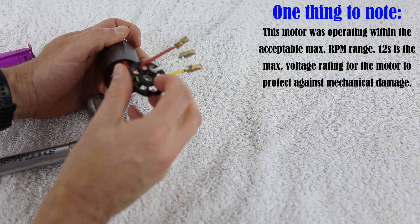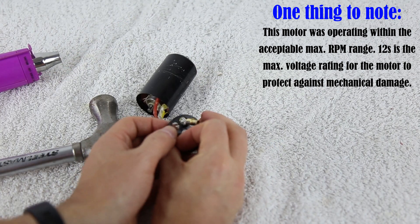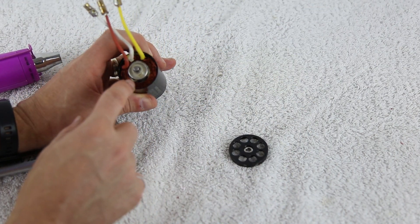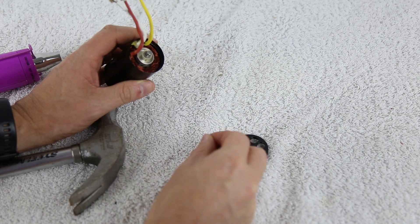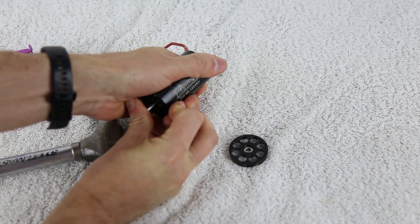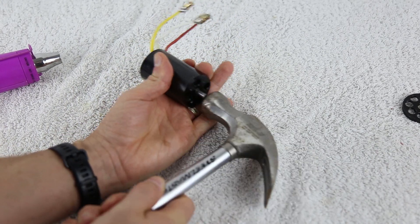Now we're going to pull this off. As we heated up this area, a little bit of glue was actually placed right on the wire. This should be easy to push through our connectors. One wire is easy, the other has a little bit of glue stuck to it — and there it goes, that released. Inside this motor we can already see a piece of what looks like a Kevlar string. We're going to continue to push the rotor out and see if we can get it to fully come out.